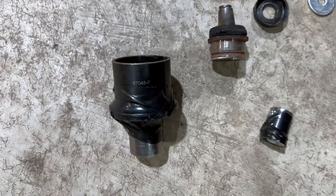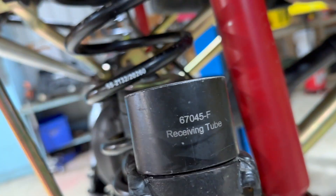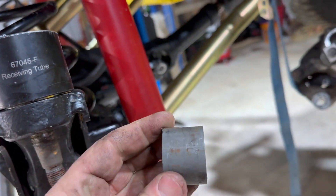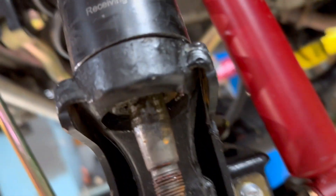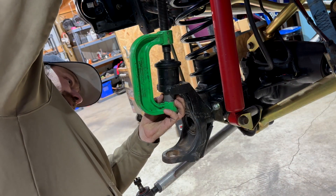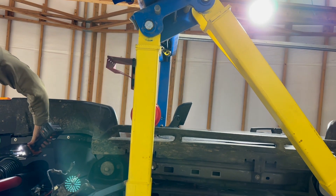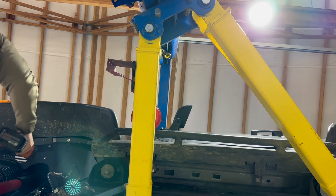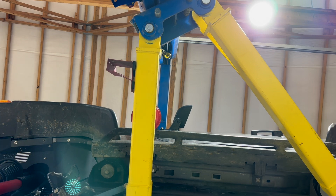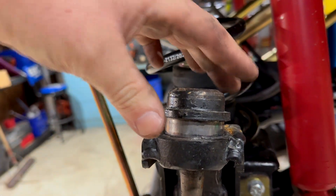I won, but that was a ridiculous amount of work for one ball joint. Working on the upper now — I've got the receiving tube and cut a piece of inch-and-a-half, quarter-wall pipe to slip up in there, then use the clamp. The camera dropped but I think it's okay. Got it.